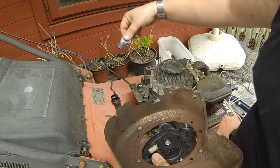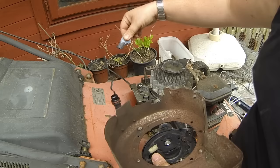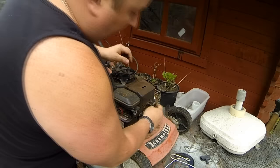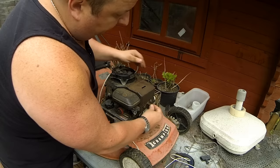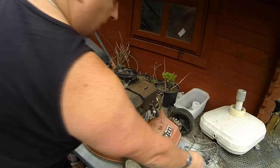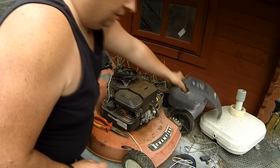Now I'm going to turn this over, lay it back there for now, make sure the dipstick goes back in where it should, and with the front cover make sure you're not pinching your cable for the spark plug when you put the case back on.